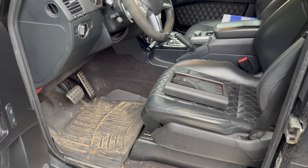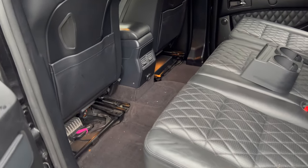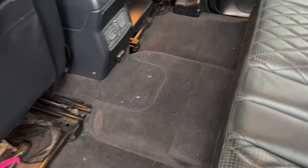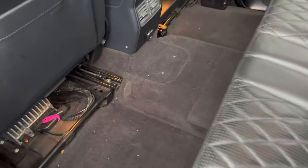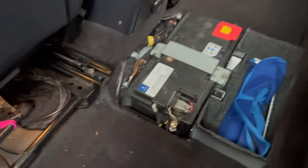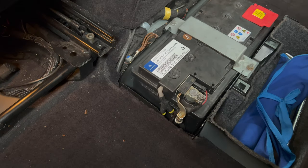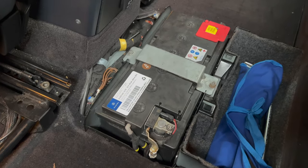We'll get these codes cleared and hopefully the messages won't show up again. To get to the auxiliary battery, it's under the main battery, which is under the center here. The easiest way is to move both front seats up, pull your floor mat out, and then this whole cover comes up. There are a couple of screws that hold it down — these two right here. Loosen those, get rid of that, and you've got your toolkit and your main battery. We need to take the main battery out to get access to the auxiliary battery underneath.